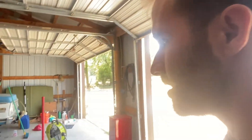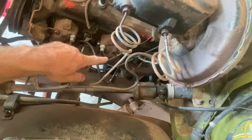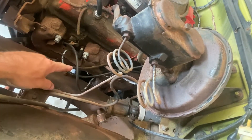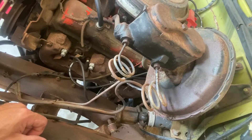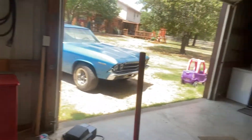I'm going to get started on this next little project — going ahead and working on getting this exhaust manifold off. It's got a bolt broken off back there and it's leaking, and that just makes you crazy. So what I'm going to do is get my little acetylene torch, heat the bolts up, and try to get this thing off there. It's a nice hot summer day — probably going to be over a hundred degrees — so I figured I better get started.